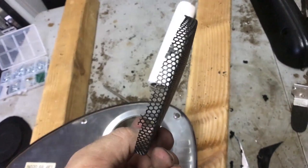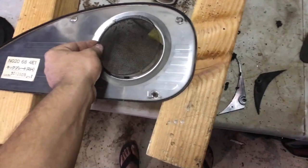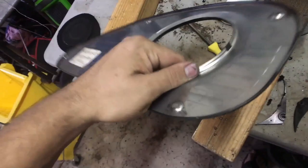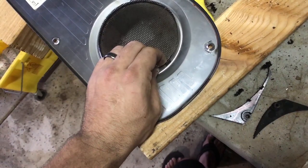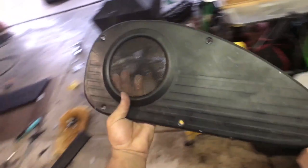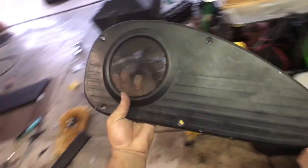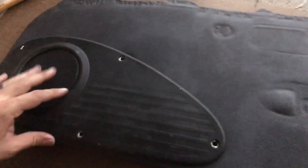Once you have that lip you can fold the fabric over and it'll just stay on. You could also drill small holes and tie it with tiny zip ties, or use small safety wire tied around a couple of times. I'm going to make a couple of holes and tie it on so the fabric doesn't rattle from the speaker. I'm also not going to use the original grille ring because it's kind of thick and it's pushing on my aftermarket speakers, so I'm going to make it as flush as possible.